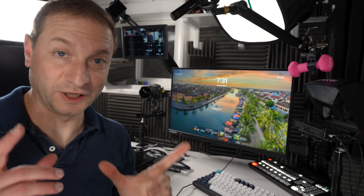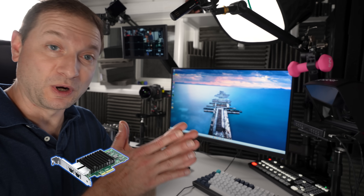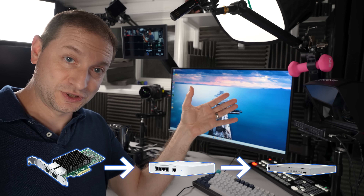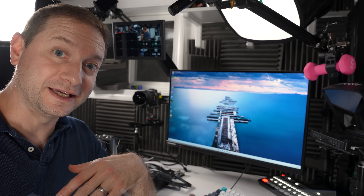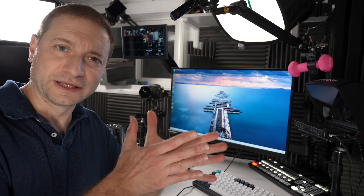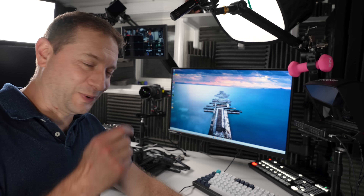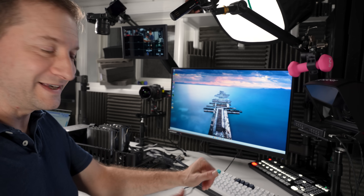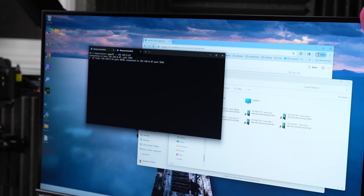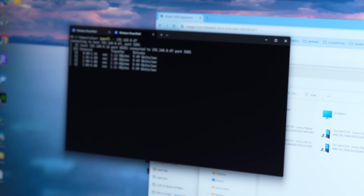This is it — it all comes down to this right here. I have this computer that I built with a 10 gig NIC in it, connected to the small XG Flex switch, connected to the big XG switch — all 10 gig. And that one is connected to the Dream Machine Station, whatever they call it. Here's iPerf running on the NAS — 9.5 gigabits. Oh yes. This is what I've been waiting for.